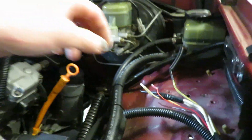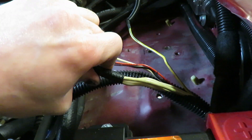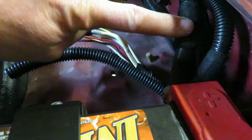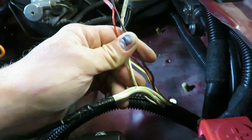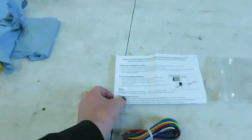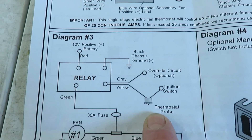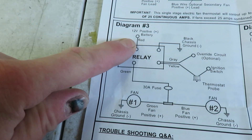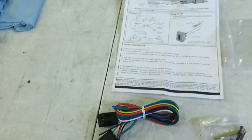What I got here is a factory Toyota harness and this bundle of white wires is battery positive. So instead of hooking yet another cable to my battery I'm gonna tap into that. There's also a switch power wire here - I'll probe it and find it, because the other side of the thermostat probe needs to go into a switch power. It does come with the wiring diagram to show you exactly how to do it - one side goes ignition and then you run battery positive right to the relay.